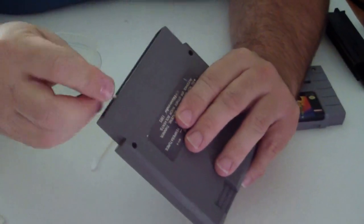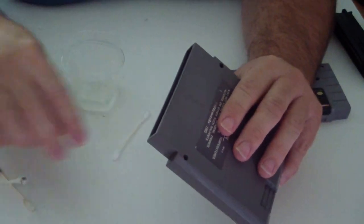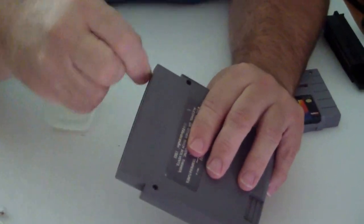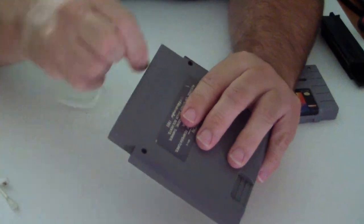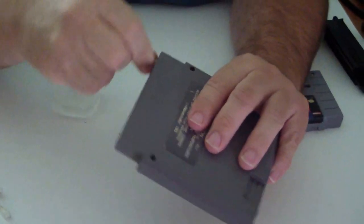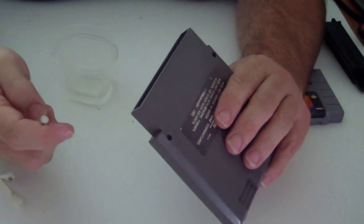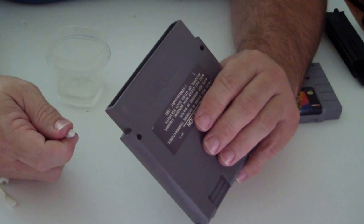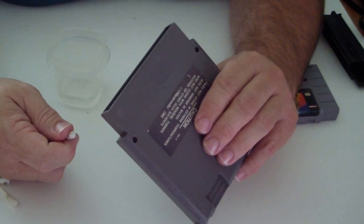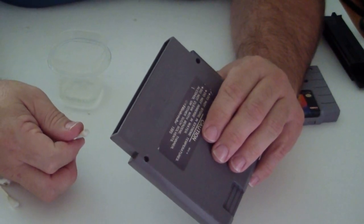This one's dirty. If you use dirty games in a system that has a new pin, you're going to wear that pin completely out. I recommend cleaning your games every so often just to keep that pin from going. If you buy a system that has the CIC chip disabled and new or adjusted pins, you're not going to have problems as long as you keep your games clean. If you pick up a game at a flea market that's been sitting in someone's basement for the last 15 years, most likely it's got corrosion on it, and sticking it into a new system will build corrosion that much faster. So you want to keep your games clean — I recommend doing this once a year.